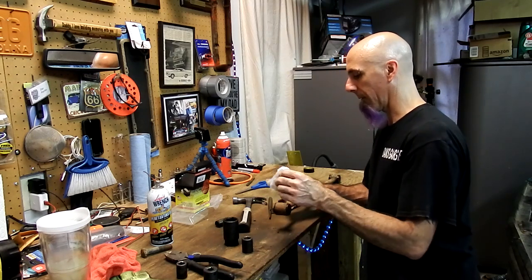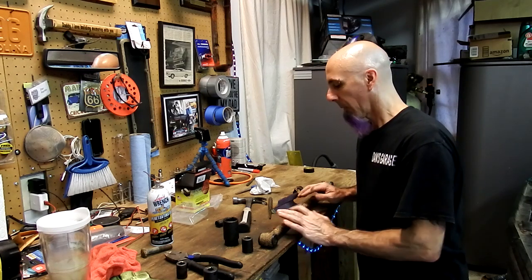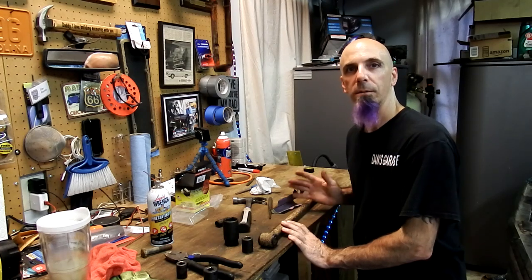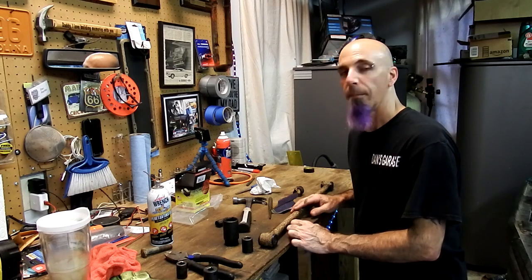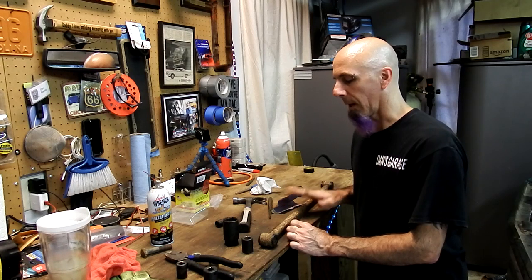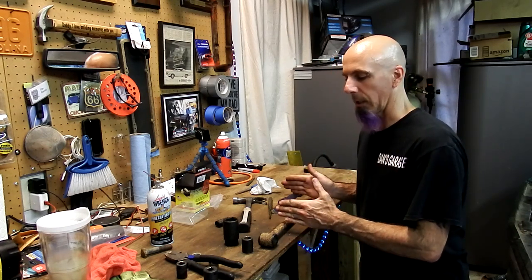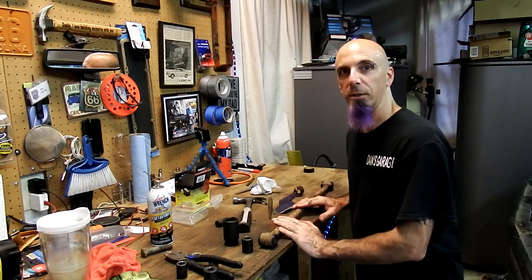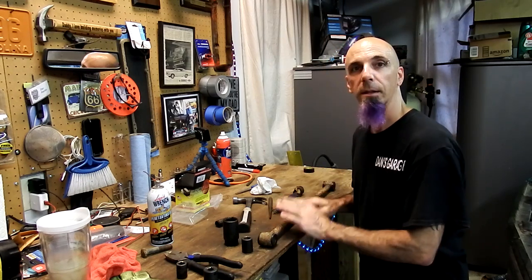This bar itself is a steel bar. Of course, I'm not really lowering this truck, so I'm able to reuse this. I'm not going to clean it up because I'm trying to keep that patina look, but if you are reusing yours, of course you probably want to paint it up and do it like I did the ones on the Chevelle, just make them look a little nicer. And if you are lowering the truck a certain amount, I'm not sure what it is, do your research, but if you lower it too much, then you need an adjustable bar, and that'll go ahead and shorten this distance, because once it's up too far on the suspension travel, you're going to need an adjustable bar. But for this one, we are good to go. So we're going to go ahead and get it back on the truck.